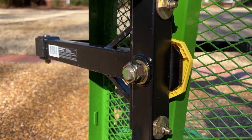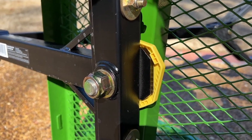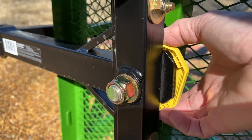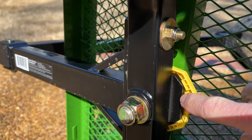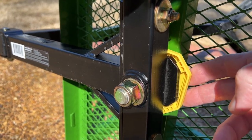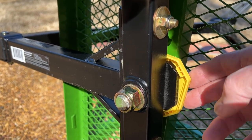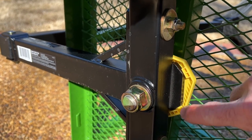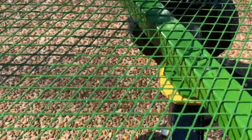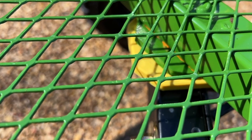Here's the underside. We're looking at that yellow cap — cover, washer, I'm not quite sure what to call it — this piece right here. The instructions don't really show which way it should go, but it makes sense: you can see it's sort of cup-shaped. Install it facing downward so it won't hold water. If you install it in the other direction the cart will steer fine, but it will hold water and cause rust. I've got it turned so it faces downwardly.